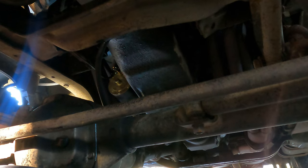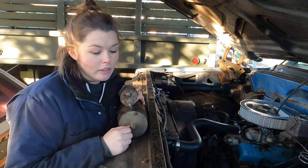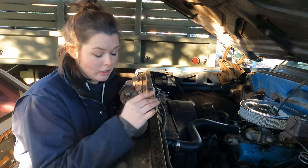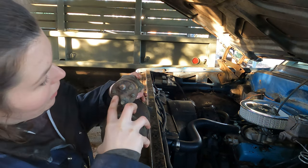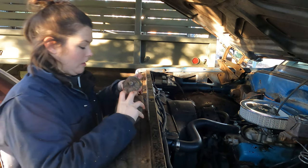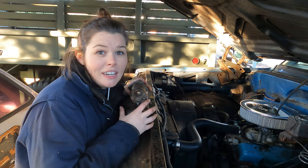Okay, and that's how you put on a starter. So I got it out — it's a little bit easier to show you what was going on up here rather than down there. I had three cables and wires all together. There were two coming off of this bigger one right here. And there's an R and an S, and I had one that was on the S. Make sure that you remember which one goes where — basically, just take it out and put it back in the same way that you take it out.